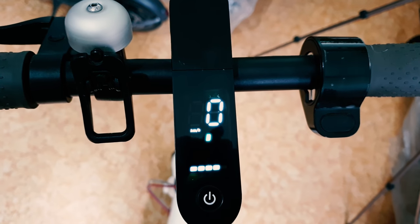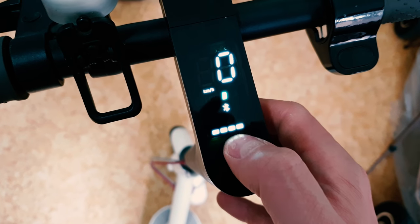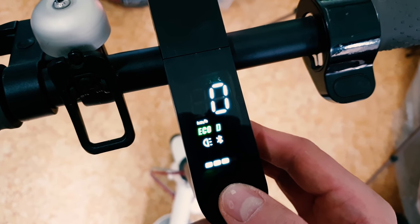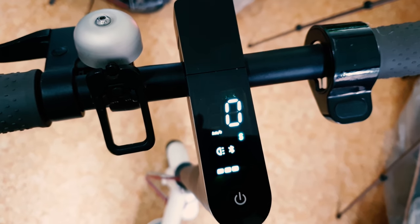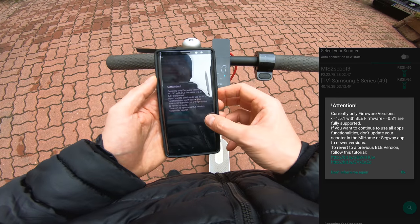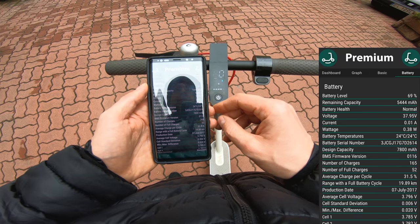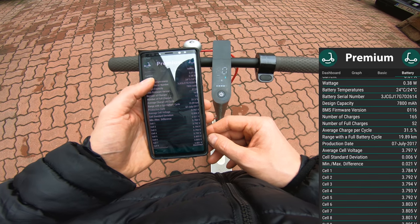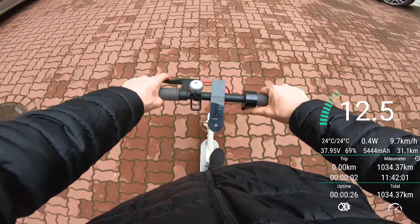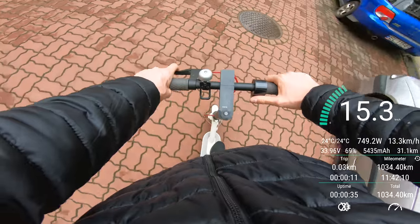Let's turn on the scooter. Bluetooth LED is blinking. We can see how fast the scooter is going, we can see how much juice is left, and I'm able to turn on the lights and switch the modes — sport, eco, and D. It looks like it's working, but more testing is needed. It was super easy — just a couple of minutes and it's done. I think it's quite hard to break the M365 because when I tried to upgrade the Bluetooth and BMS firmware about 50 times, every single time there was some error or the scooter switched off, but when I turned it back on it was still working fine. So no worries — if you're a noob like me, it can be done with basically no way to break the scooter.